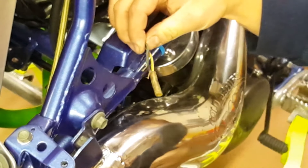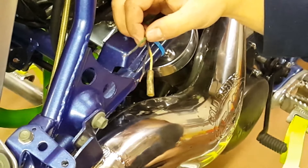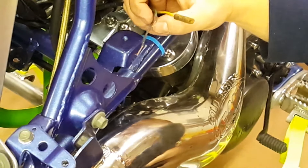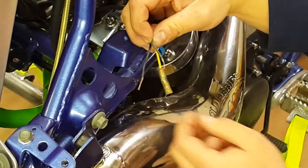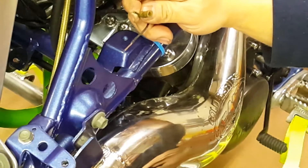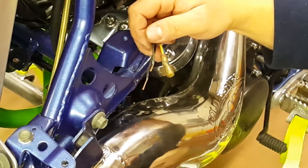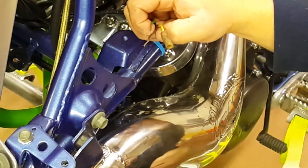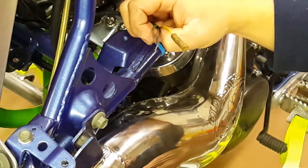Now here on our wire harness you have three wires, whereas you only have two on the lights. One of these is a ground, and then you have your high beams and your low beams. The yellow is your high beam, the green is your low beam, and the black is your ground. What I'm going to do is twist the green and the yellow together on this one — that way, whether you have high beams or low beams on, this light will always be on. Then on the other light, I'm only going to do the high beam, so when you're on low beam the left light will be on, and when you're on high beam both the left and right lights will be on. That way you can have one or two lights on — probably always have both of them on, but it at least has some functionality.